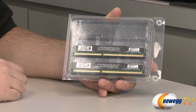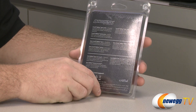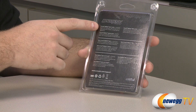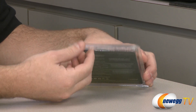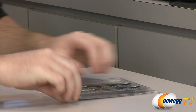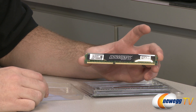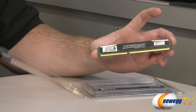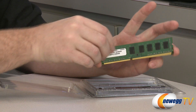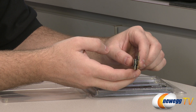Let's start off with a closer look at the Sports. This is a 16 gig kit, so 8 gigs on each stick. The Sports series is aimed more at the mainstream market, so you're not going to find quite as high speeds or as tight timings on these, but they're going to be priced a little more aggressively and should fit most homebuilders' scenarios — whether you're building a gaming computer or a general use computer and you're not looking to set any benchmarking records. When you talk about half height memory, Crucial has really taken this to the extreme. I have a standard non-heatsynced DDR3 memory DIMM here for reference, and as you can see, these are truly just about half height memory sticks.